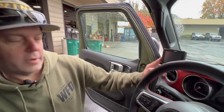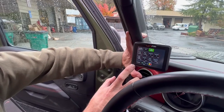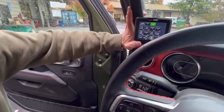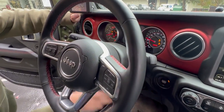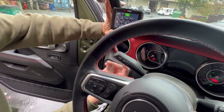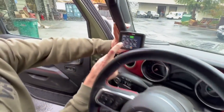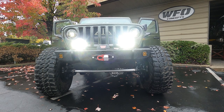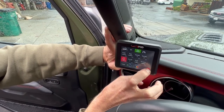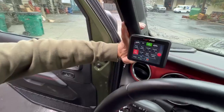Alright, so here's the S-Pod. What we're going to do to wake up the S-Pod — we just tap on the screen. And as you can see, we already have our switches labeled: front locker, rear locker, these are our LP6s on the front bumper, rock lights, reverse lights. The fog lights are programmed into the factory fog light switch. We'll turn the key on real quick — this will be our fog light. Now the turn signal is blinking through the LP6. The LP6 will turn on here on the switch — it's at 100% right now, which is wired to the high beam wire. We can dim this all the way down to off, or go all the way back up to full power, or run like a low beam at 50%.